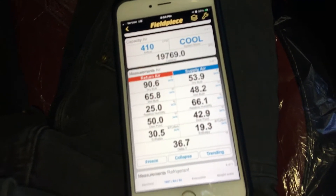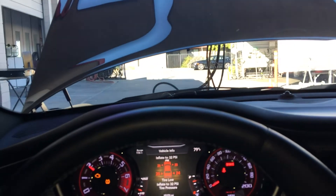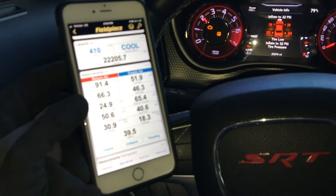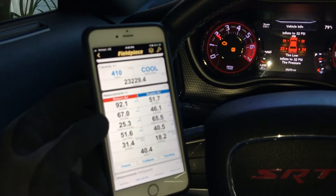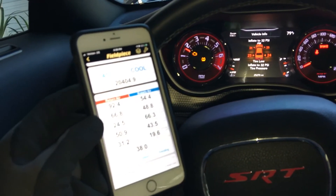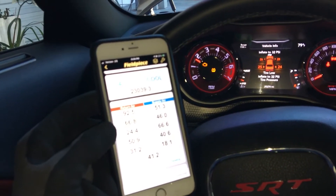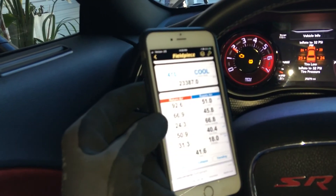So that's where we're sitting. I know when I run it up and keep it at idle on this vehicle, I should have a fan outside in front of the radiator blowing over the condenser to get the proper temperatures. The way they have the fan, it's fixed at a really low speed and it never goes up. I believe because of these modifications they have the ECU and everything overridden inside this vehicle, and the regular fan controls are not kicking in.